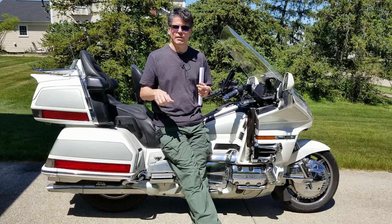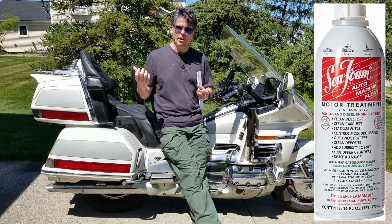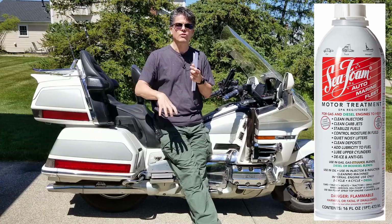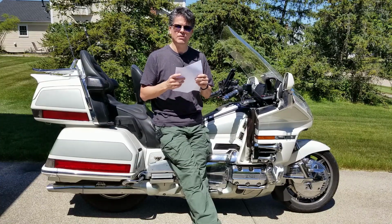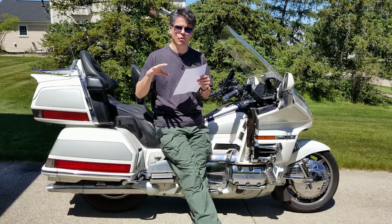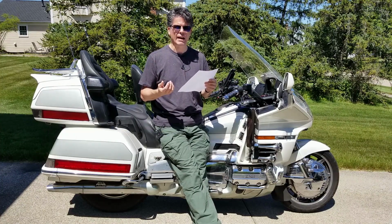If it's still going on, take your gas cap and buy a can of Seafoam. I'll put a link to that in the description below. Put the Seafoam in a bowl and soak your gas cap in it for a night. Let it soak overnight. That will get rid of any deposits that may be potentially holding the valve open or closed. If that doesn't do it, you might want to look at a new gas cap.